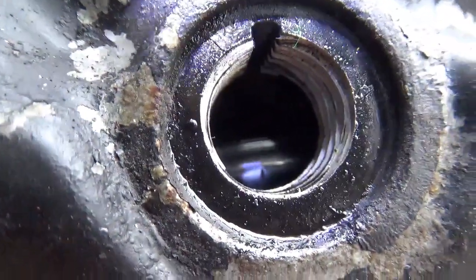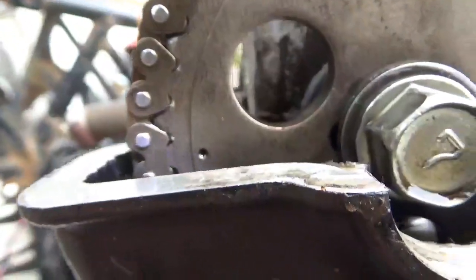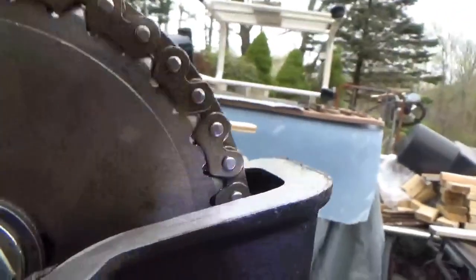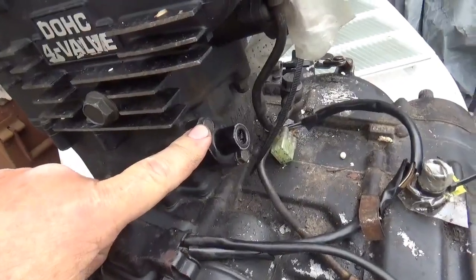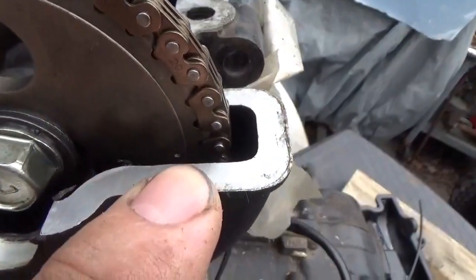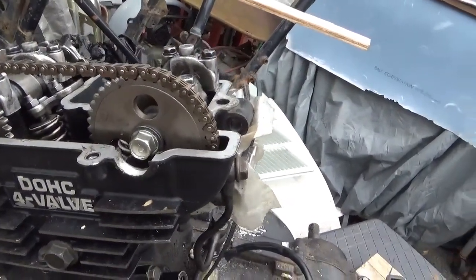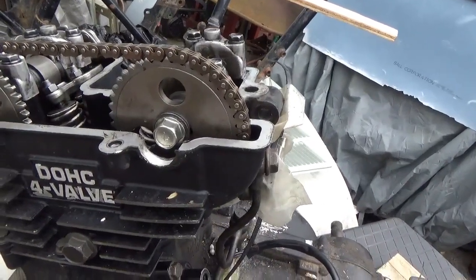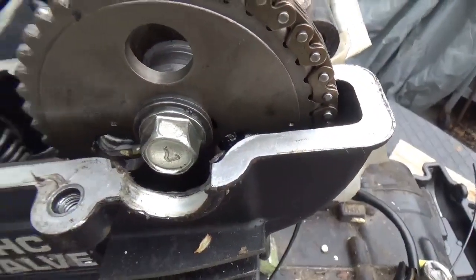You can see the little notch in there — lined up with the top notch — so that's good. You see how that dot is right there, which is good. But you see how that other dot is below the waterline — that's not good. So what I have to do is pop this out again, adjust one more time, and put it back together, because I think that's one notch off. If you're one notch off it might run, it'll probably run, and it'll probably be hard to start — but why be one notch off? Let's fix this.